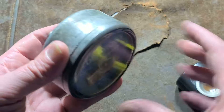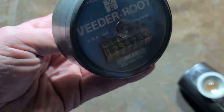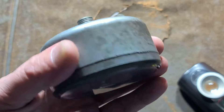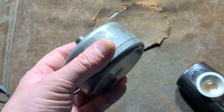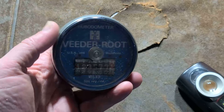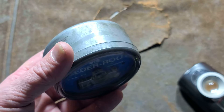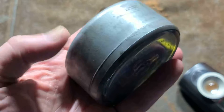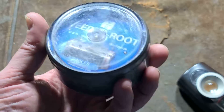This is mounted right on — there's a little threaded portion — right onto the axle. Some axles actually have threads specifically for easily mounting these, and sometimes there are brackets you can get. But this is not cushioned by any type of suspension. Semi-truck tires can be 100 PSI and they're bias ply — rock hard to support the loads. So every single pothole and bump, think about the shock loads of hitting a pothole at highway speed on a semi-truck tire when this is just mounted inside the wheel. It's surprising that this fitting actually takes the force — this thing weighs a good couple of pounds.